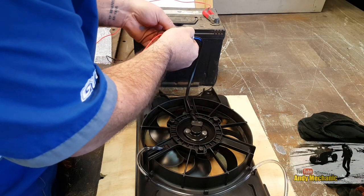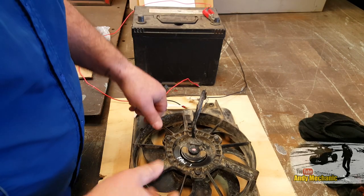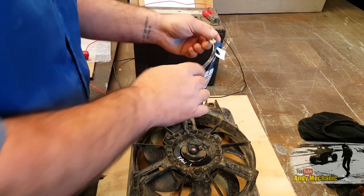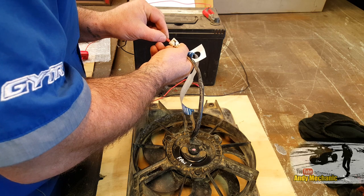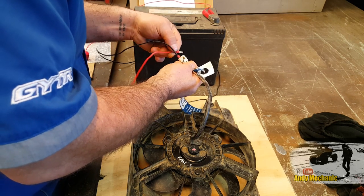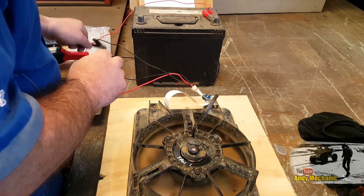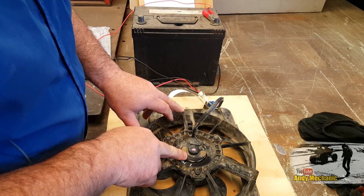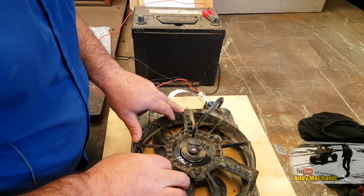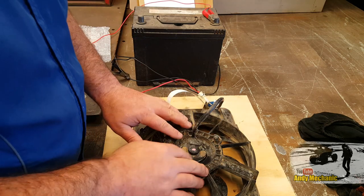We'll unplug the brand new fan. Now, I'm laying them down on a piece of wood because I'm actually trying to get the motor to work a little bit harder, as hopefully that will highlight any points of resistance in the fan. We put the earth back on — the black wire — and the positive. Excellent. Let's give it a quick test. Now this one, as you can probably already hear, is very noisy. The front bearing has obviously had water in it, causing the bearing to pit and get a little bit of play on it.